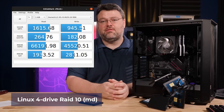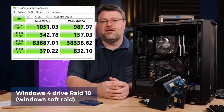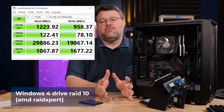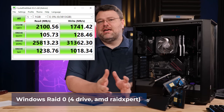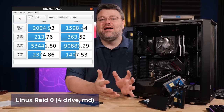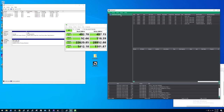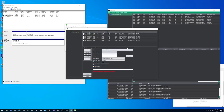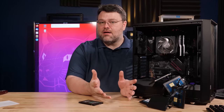We also tested a four-drive RAID 10 — a simpler setup, easier to do the math. Similarly, we found the performance kind of lacking with the AMD RAID drivers. The settings by default are pretty conservative in terms of caching, which is probably better for data protection. We set everything to write-back caching, which opens the possibility of having the RAID array in an undetected inconsistent state after a power outage — you could write information that makes it to one of the discs but not the other. So I can't blame AMD for being conservative with the default cache settings. If you understand the risks and want to enable write-back caching you can do that via the GUI, and you do get a performance benefit for writes — but be aware that option doesn't help you with reads, because something is wrong with the reads.